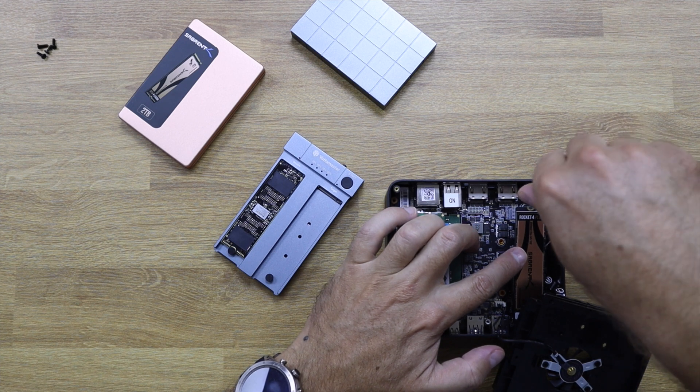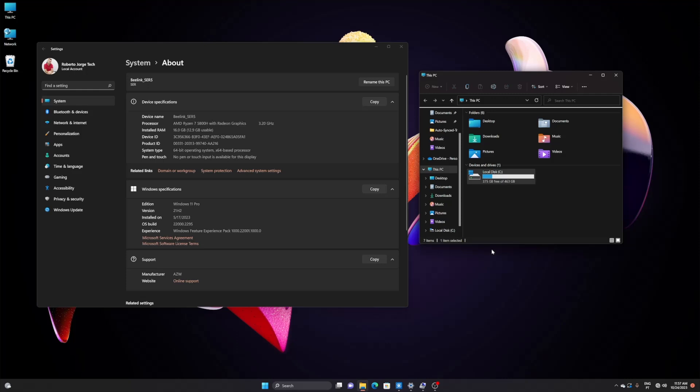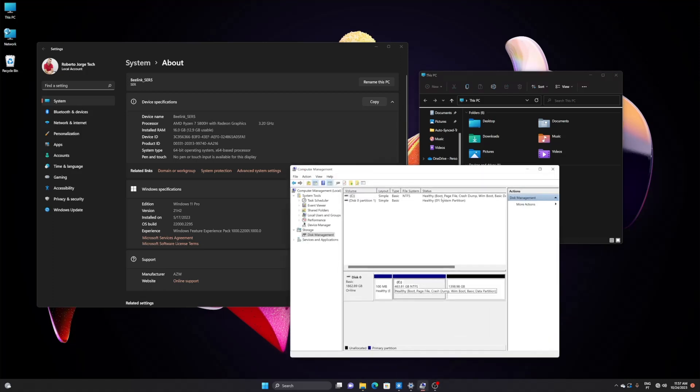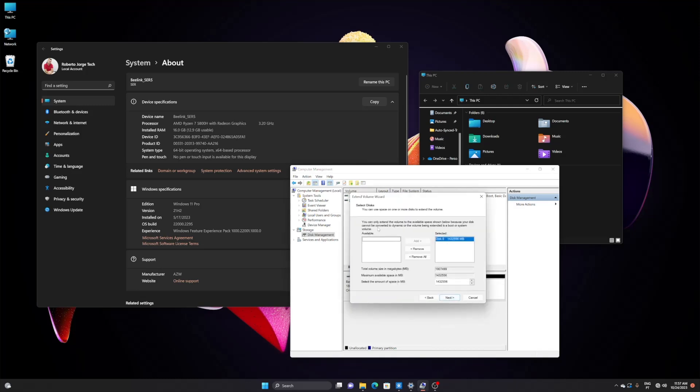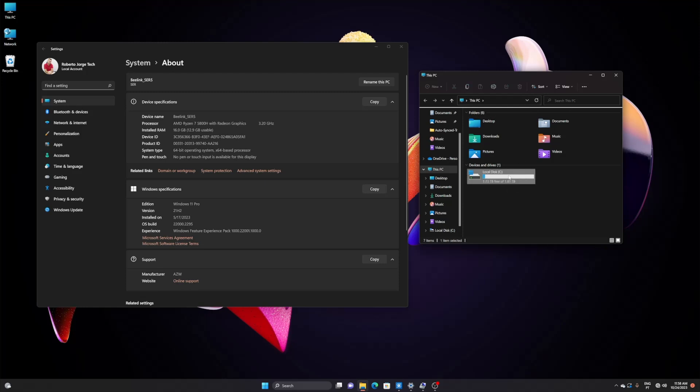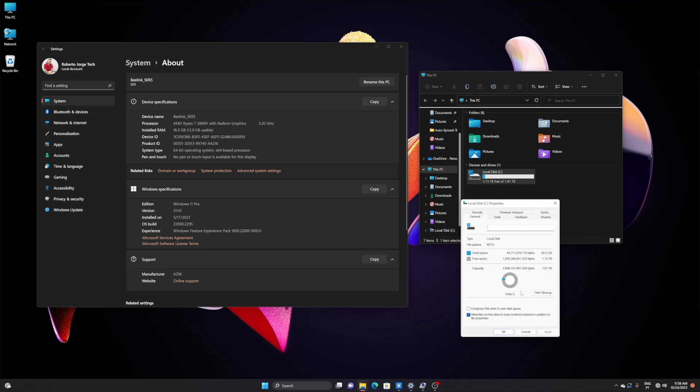The speeds are great at 10 gigabit. To verify the clone, I installed the new Sabrent 2TB drive and booted the system. It booted into Windows successfully. The only thing I noticed was the disk was only showing about 500GB used — because cloning copies exactly 500GB to 500GB even though the drive is 2TB. This is simple to resolve: just go to Disk Management and expand the partition to use the entire disk. After a couple of minutes I had the full 2TB available — a successful operation.